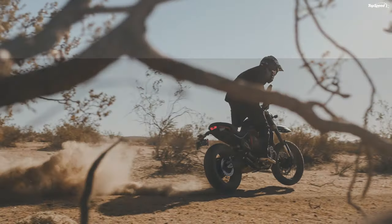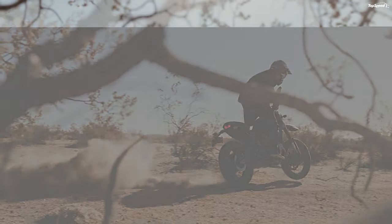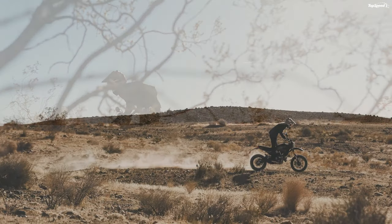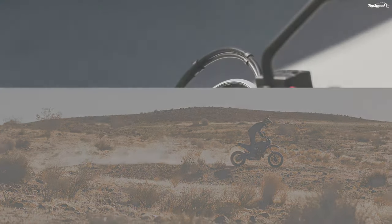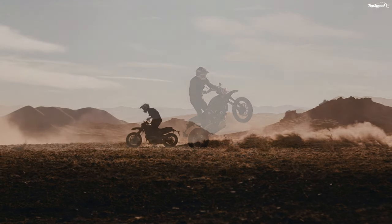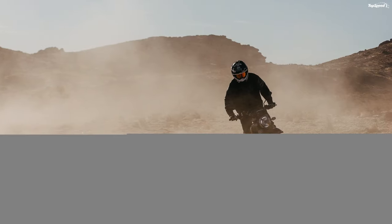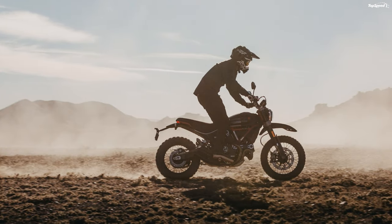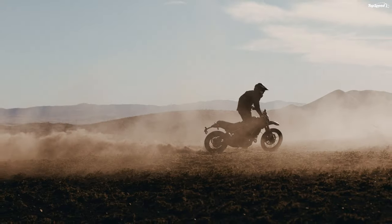2021 Ducati Scrambler Desert Sled Drivetrain. To finish the higher electronics on the Desert Sled and Desert Sled Fast House, ABS can be disabled through the off-road riding mode that lets you dial in the power delivery for your off-road adventures. Ducati powers the Desert Sled with its air-cooled 803cc L-twin. It's a desmodromic engine, so it replaces the usual valve spring with a cam and follower that provides positive closure for the dual poppets in each head. The valve lash adjustment is critical on this mill, but it prevents the deadly harmonic valve float that can occur at high RPM on sprung engines.